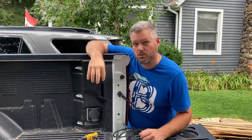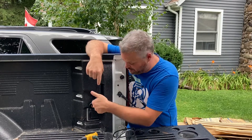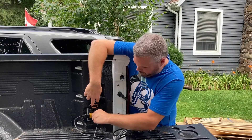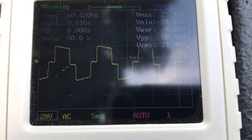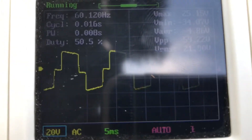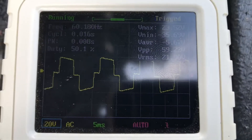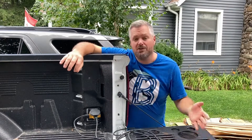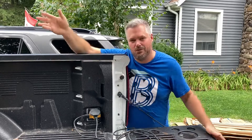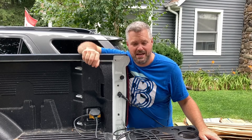We're back in the right-hand corner of the bed. It's rated at 400 watts — it says AC 120 volts, maximum 400 watts right on the little cover. Plugging in, you can see my light comes on because the switch is still on from the dash. And just as I thought, we have basically the same waveform here. Likely, if we found a wiring diagram, we could confirm that these outlets are in fact connected together.